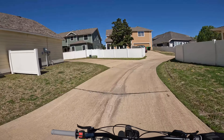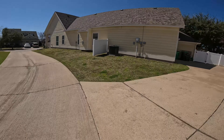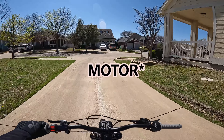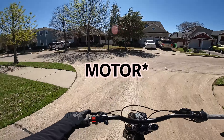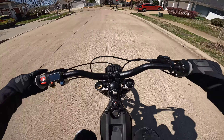I'll link a video in the description on how to do it. There are multiple videos on YouTube about it, but basically you have to loosen the engine mount bolts and move the engine a little bit to loosen up that belt, and it fixes the sound. Now my bike doesn't whine anymore.